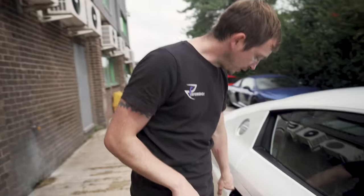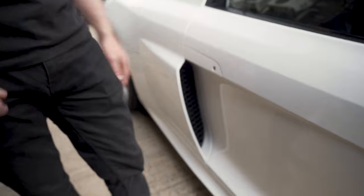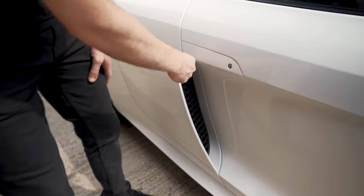So, this is a 2011 R8 V10. So this is what we would call a pre-facelift. So there's obviously the V8, and then the V10 started 2 years later, 2009. V8 started 2007. And then they run up to 2013, and then that's called the facelift. And the facelift runs to 2015, and then 2015 onwards is a Gen 2. So the easy way to tell a V8 from a V10 is the side blades. So the V10's got the kick here, and a V8 has got a flat blade.